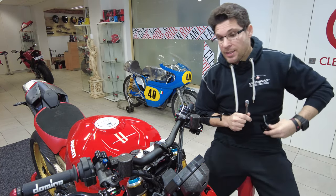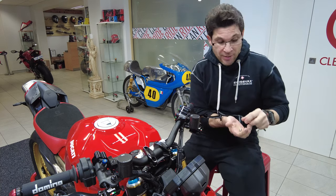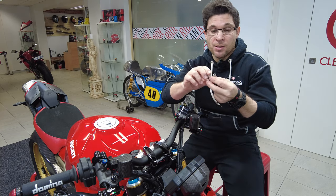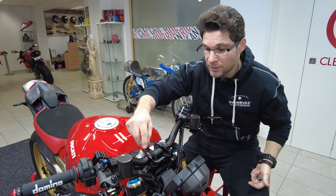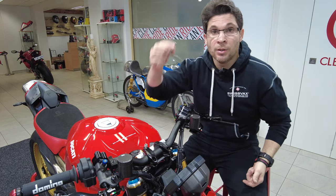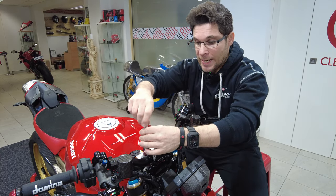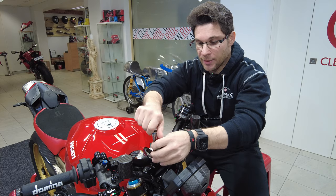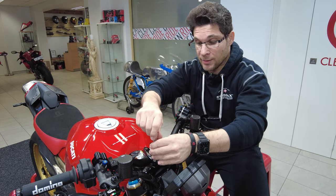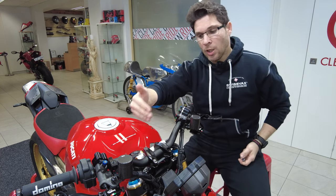With the CNC ones — and the stock ones — you've got to be careful. The CNC goes outwards, that's the way it goes on. You get four screws and two are different sizes — longer and shorter. The longer size goes at the back closer to the rider, and the shorter side goes on the front. Then all you need to do is hand tighten them equally and then torque them down to Ducati specifications.